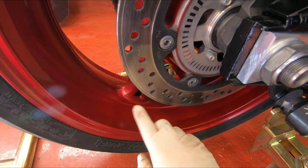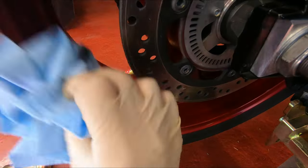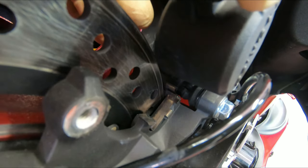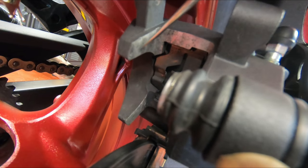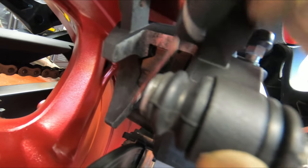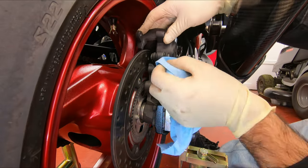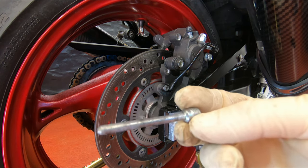All that sanding material that falls down on the wheel — don't go too hard because that could scratch your wheels if you put too much pressure. Just go like you're dusting off. And the caliper — if you want, you can slide it off to lubricate the pin, but this moves really freely so I don't have to mess with that. I'm just gonna clean these surfaces, over here on the piston, on that clip, this clip, and this one too.